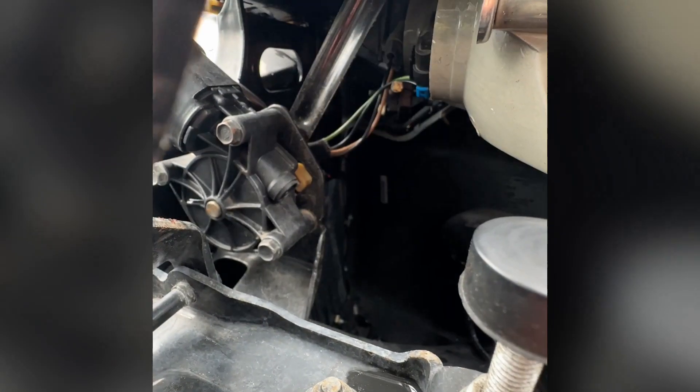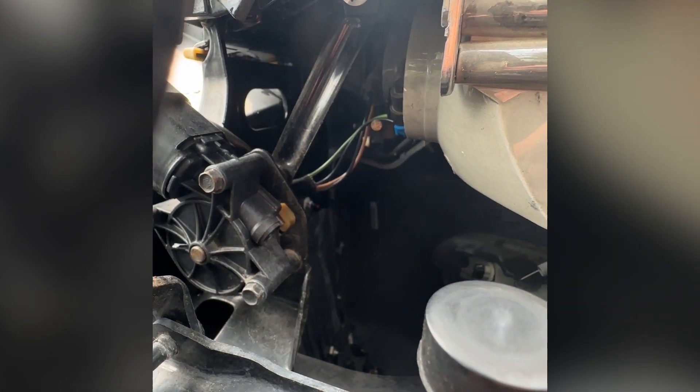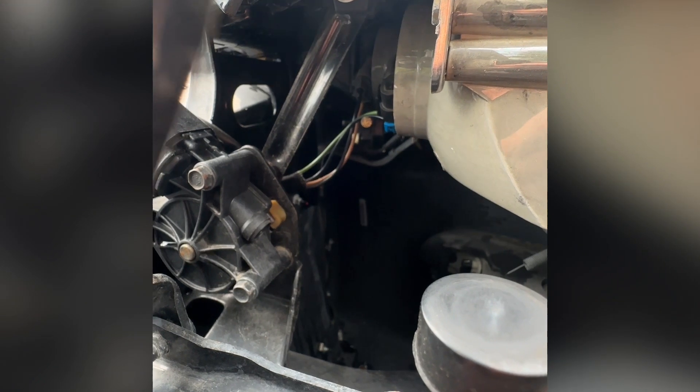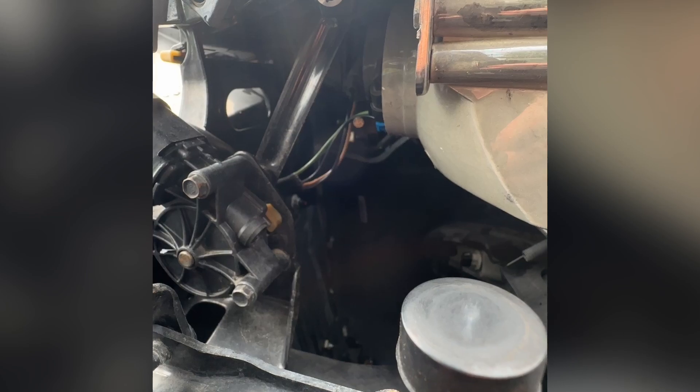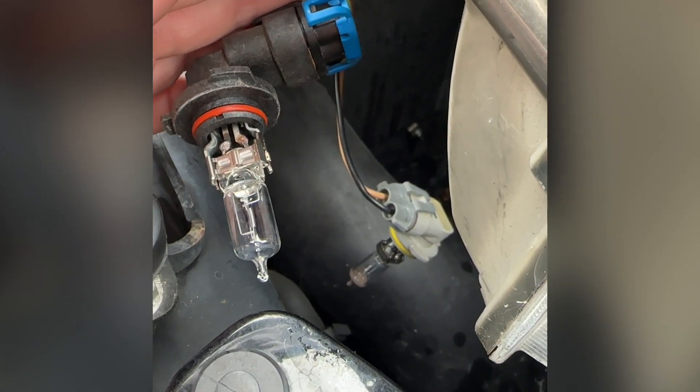It's going to be a little difficult to see here on the camera, but if I get my phone back in here on the wide view, you can see some of the wires back here — that's where each of your bulbs are going to be. The inner bulb on the driver's side is going to be your high beam, and the outer bulb is going to be your low beam. It's simply a matter of twisting it out and pulling out each of the bulbs, then putting the new ones back in from Vet Lights.